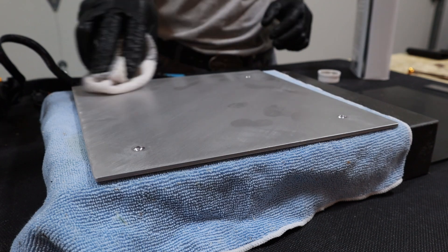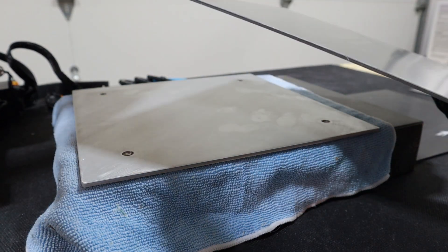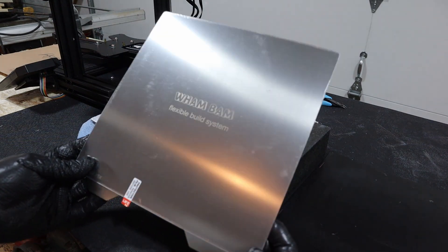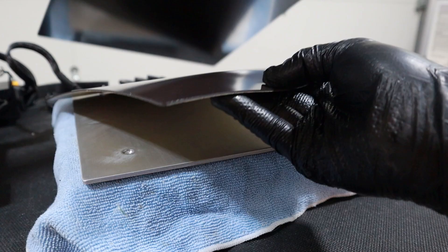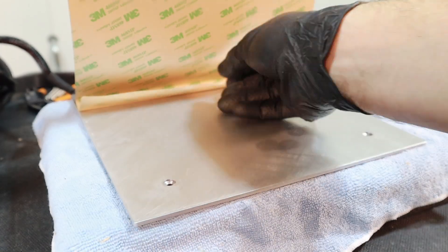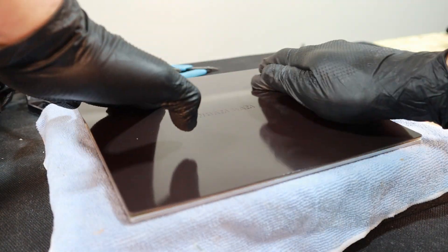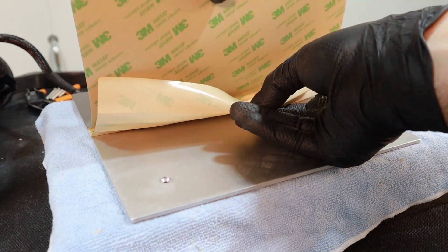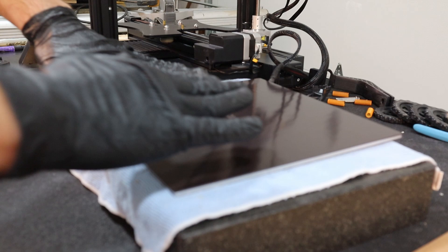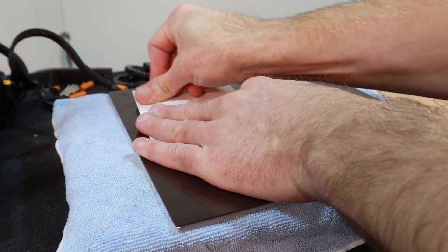So now this needs a thorough cleaning. I'm using alcohol and then I'm gonna follow up with some acetone. There are four holes to contend with and I don't think it's wise to cover them up, so I think we're just gonna stick it on and then deal with the holes afterward. Sticking this on is pretty simple but we've only got one shot at it — peeling just a small amount off the backer and getting that back edge started, making sure to press from the inside working my way out. After everything's been adhered I'm gonna use a piece of thick paper to press down a little bit more firmly to make sure we have good contact everywhere.